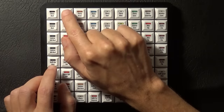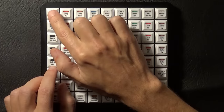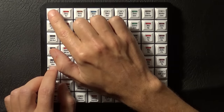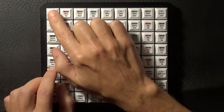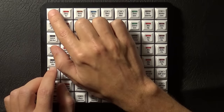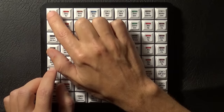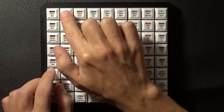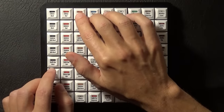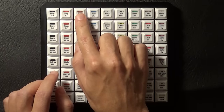So here's 45. The force you need to press down the Cherry MX Red is 45 grams, and to press down the Cherry MX Black is 60 grams. And I can feel there's a bit more resistance here. I need to press a bit harder too. You can also hear a different sound, I guess. But these are linear. I can talk a bit about this when I have introduced the other two categories. So let's continue with the tactile ones, the brown ones.